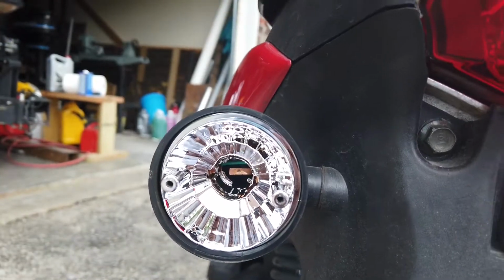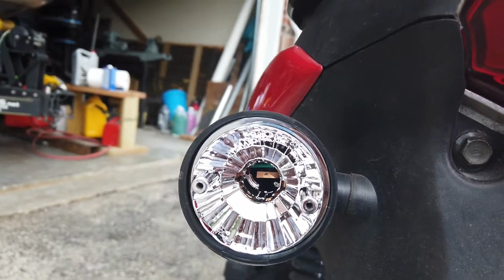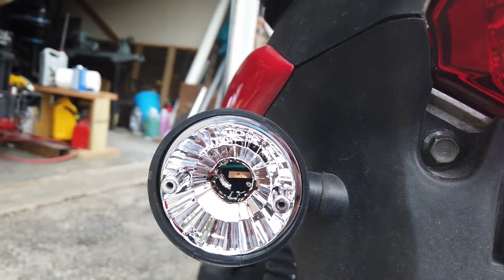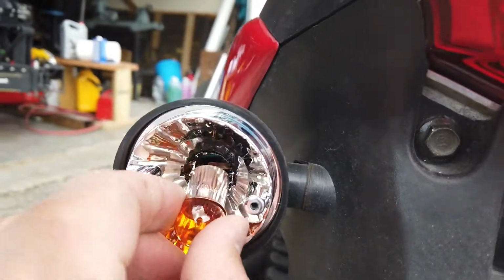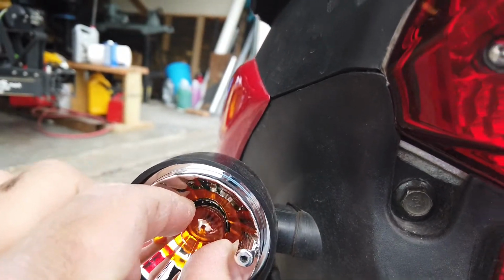This may look different in a car, but there's always gonna be a contact on the back and a contact on the side. Side is sometimes a screw-in socket, like a house light bulb. But just bend that back contact forward. Sometimes you have to stick something behind it. I've used like a little piece of a business card in the past. Seemed to work.